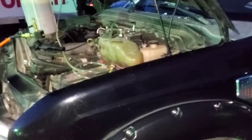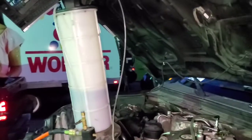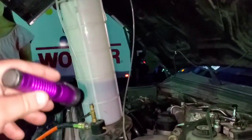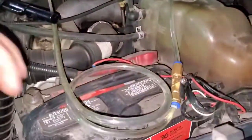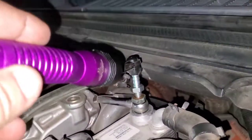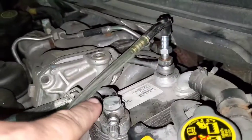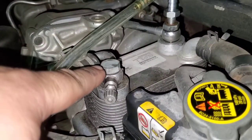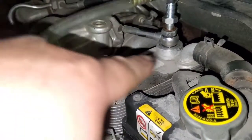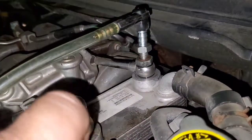I'm just going to show you real quick how I do it. There's fancy tools out there, but this is my method. I've got a fluid evacuation pneumatic container and the hose that comes with it. You can make your own — as long as you've got a rubber piece right here. Now, this little concoction uses your banjo bolt. I took a banjo bolt, drilled a hole in the top, tapped it, and put a barb fitting in it.